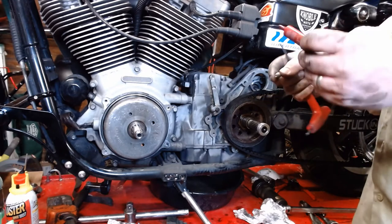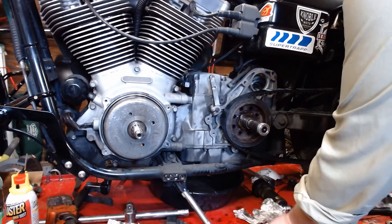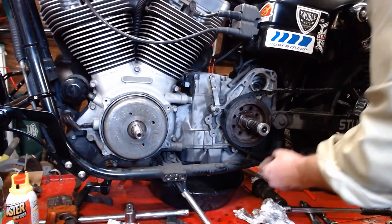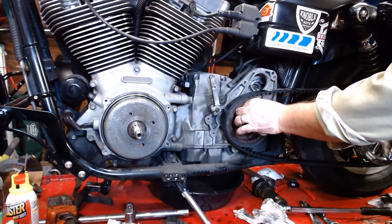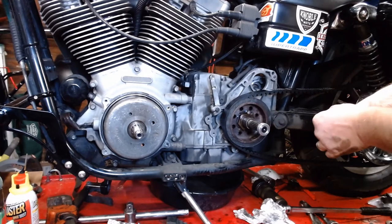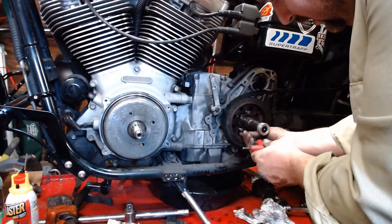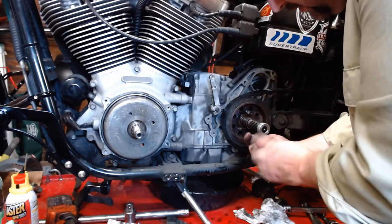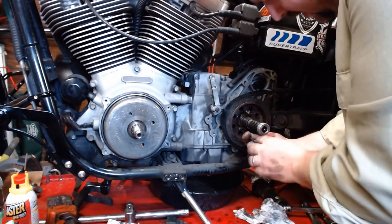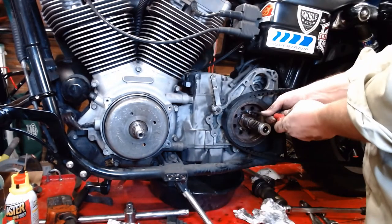So, anyways, got our medium strength thread locker here. Whoop, little dab there. Remember, a little dab goes a long way. Put that excess on the old one there. We're going to thread that in there. Now, keep in mind, whichever hole you thread this in, remember, it's left-hand thread, so wherever you thread it, it's got to prevent it from turning to the right. So we're just going to run the head of these screws down in here, and this does work. I'm not going to lie, it still seems weird to me, though. And tighten those up to the manufacturer's specifications.